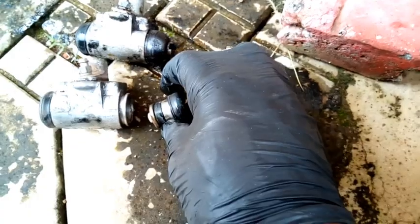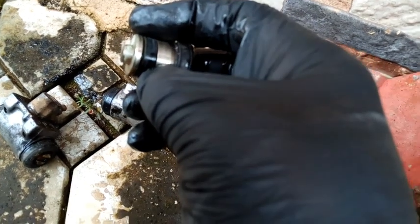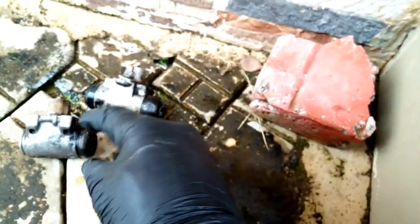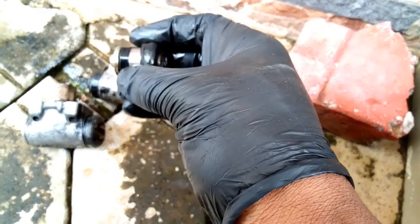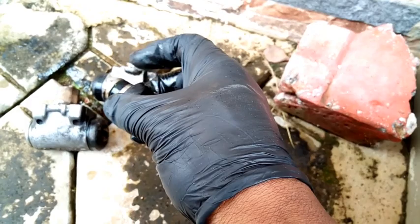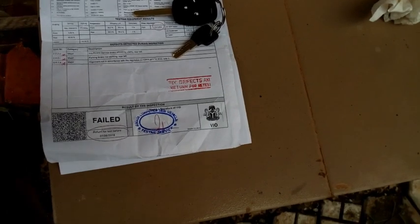I've already removed one side of this one, so this is hollow. But the important part is this. You see this rubber, more like a big size O-ring. Over time that will wear, and even though I wasn't having external leaks, although I had one pinhole in the rubber boot, and I wasn't dropping brake fluid anyway, internally this was leaking. Brake fluid shouldn't go past this O-ring, but it was going past it on the wheel cylinder on the left, and that was the cause of my problem.